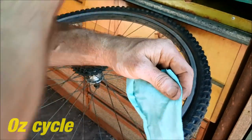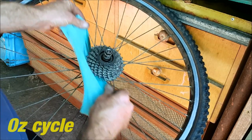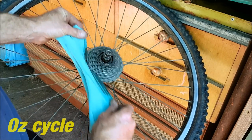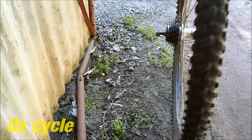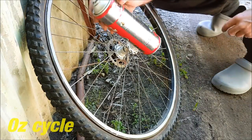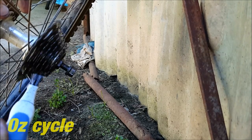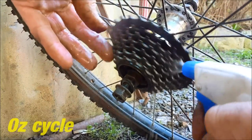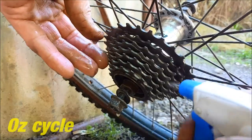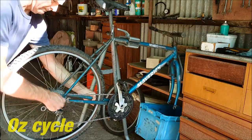Cleaning the rear cogs is fairly easy. Get a clean rag, fold it in half and spray some degreaser on the fold. Place the fold between two cogs and move it back and forth, then move up to the next set of cogs and so forth until you've done them all. Don't forget to clean behind the first cog and on top of the last cog. Another way is to lean your wheel downwards on an angle, spray the cogs with degreaser, and using that same narrow stiff-bristled brush, give each cog a scrub. Then use the spray bottle or a hose to rinse the degreaser off — always keep your wheel at an angle so the waste runs away from the bearings.